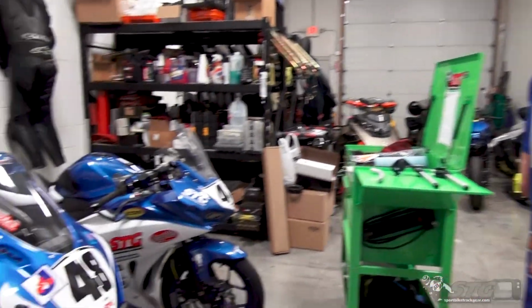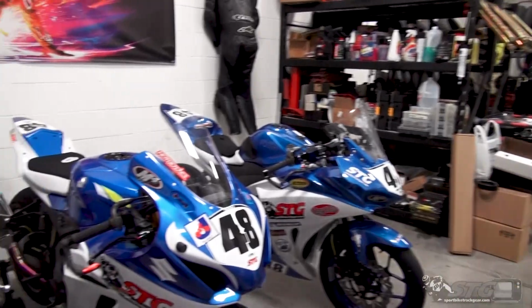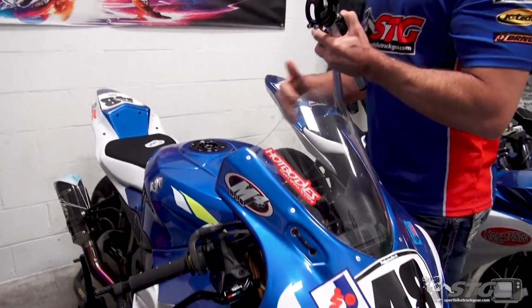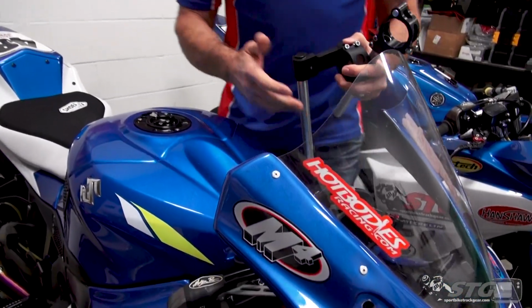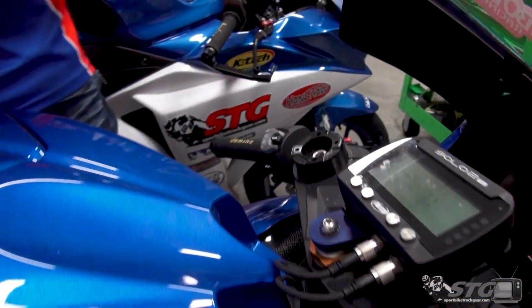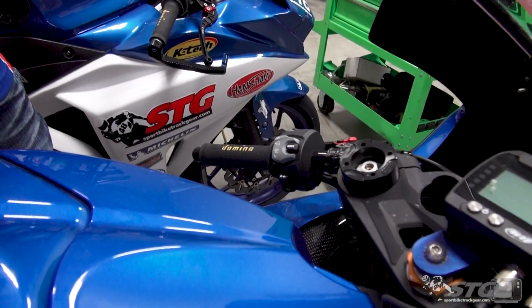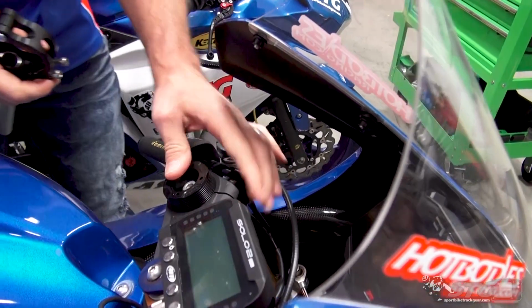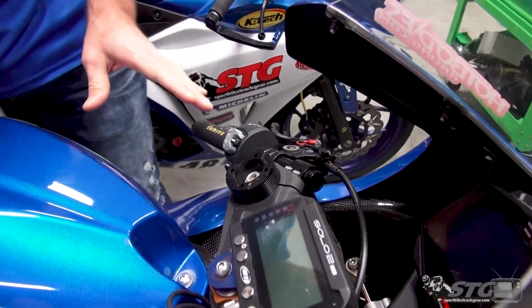I've got a couple of different clip-on options. The clip-ons we have on the bike right now, they're a pair of Vortex clip-ons. It's a 7-degree down angle, so it's the most common, right? And it replaced the OEM clip-ons that were also underneath the triple tree. It changes the reach to the bars a little bit.